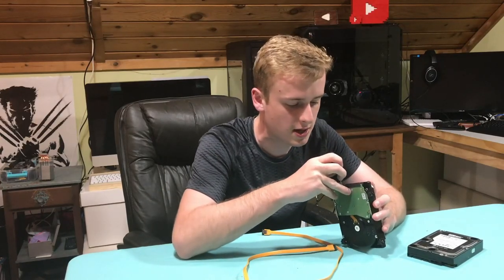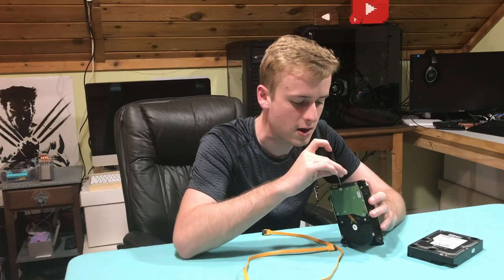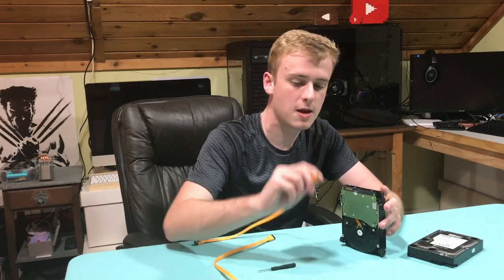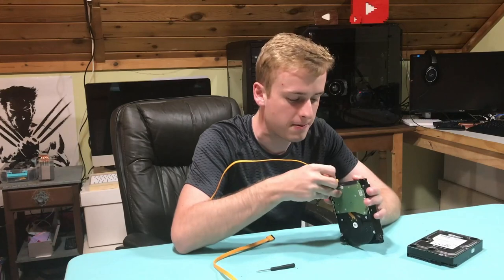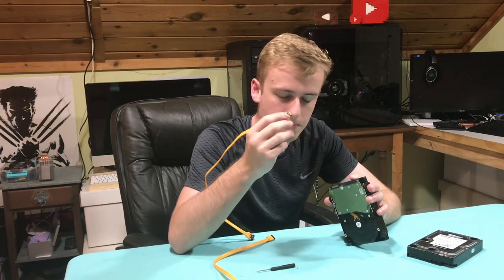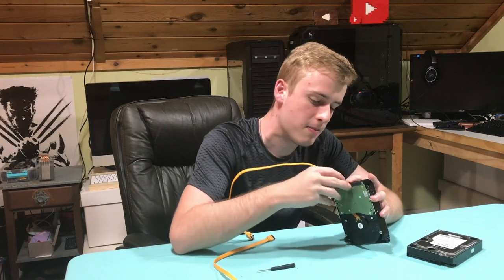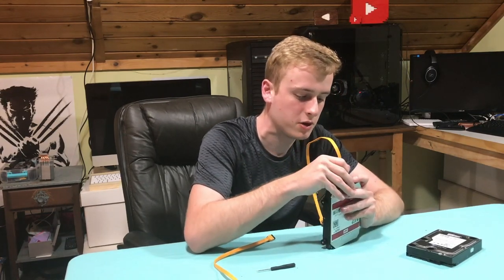As you can see, it's got a very fine tip. What I did is I just rotated it right above the connectors, and then I basically took the SATA cable on the side I've chiseled away and sat it on there with the release clip on top. And then you're able to get all your data off as long as you're holding it.